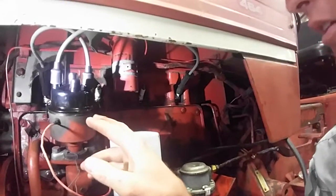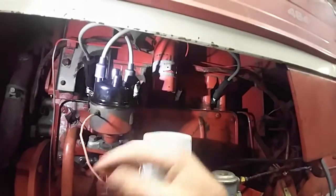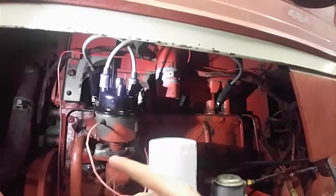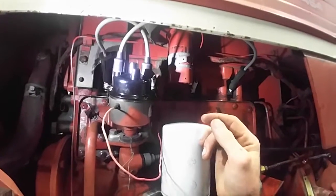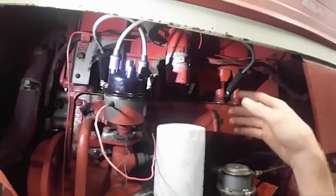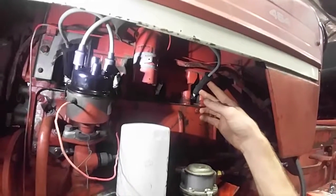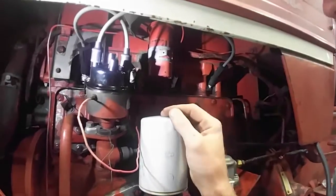It's very important to know your firing order. On this one it's gonna be 1-3-4-2. On a straight inline engine, one is always at the front and whatever number you have — whether it's four, eight, twelve, or whatever — it's gonna be at the back.